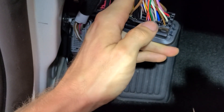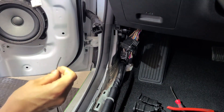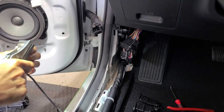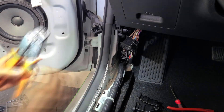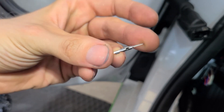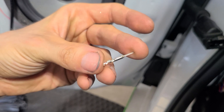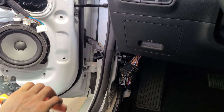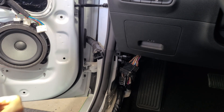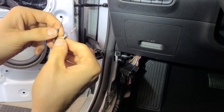I'm going to be using these top two pinholes right there, and positive is going to be my top. I've got some 18 gauge wire here and I'm going to strip it back and then crimp on those terminals. These are what the pins look like, by the way — they are not standard normal pins. Of course not, because Hyundai couldn't use something universal and generic. Gotta have some special OEM pins. There we go — they're not the prettiest thing, but they are connected and they will do the job right.